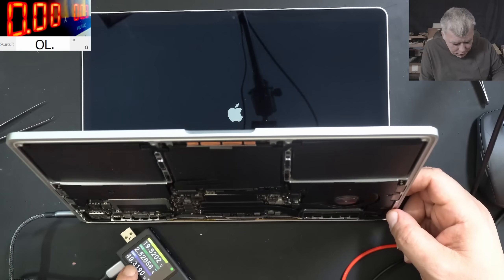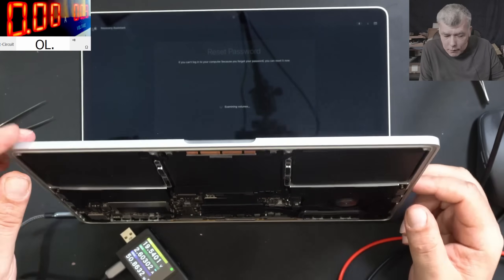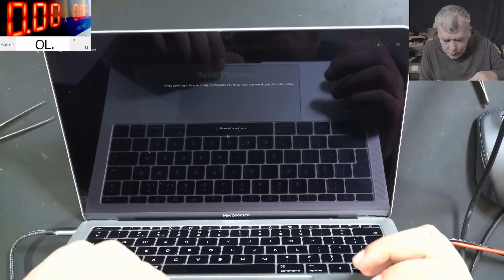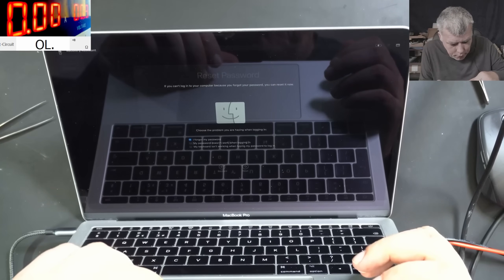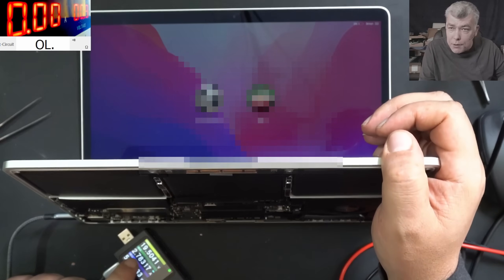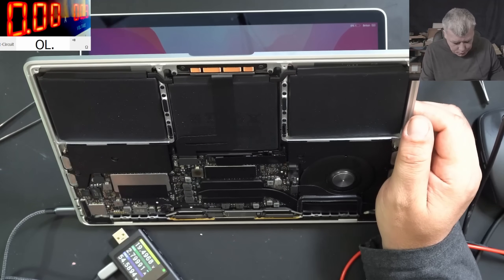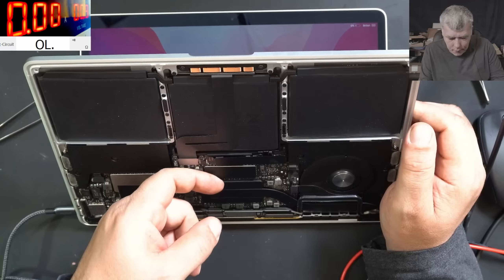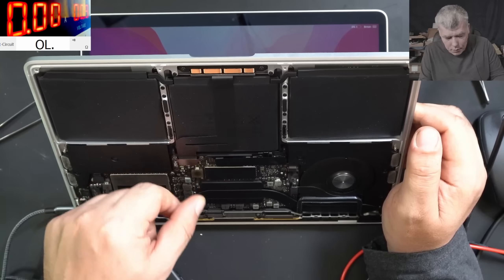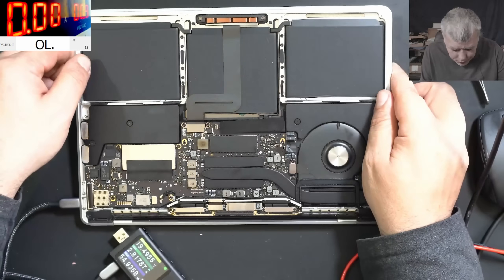It is coming on! Taking like 2.5 amps — the laptop is coming on. There's a prompt to reset the password, but we don't want that. Restart. The laptop is coming on, taking 2.7 amps, and we have the charging sign on the screen. It's charging — we don't have the X anymore. 2.8 amps. This coil is hot, but that's fine — this is the charging coil. I can't see any problem with that coil. We fixed it.